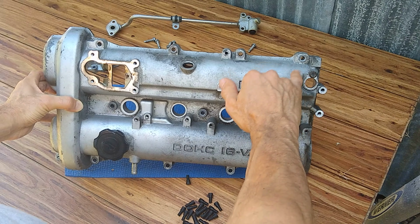We're going to be blasting with extra fine glass bead media, only the machine surfaces and the inside as well. We'll be blasting using the version 3 vapor blast gun. I'm almost done with the testing on it. The thing works great. Flow rate is really good. Currently it has a 9mm tip on it. The 9mm tip is very taxing on the compressor. I'm going to step it down to an 8mm tip.